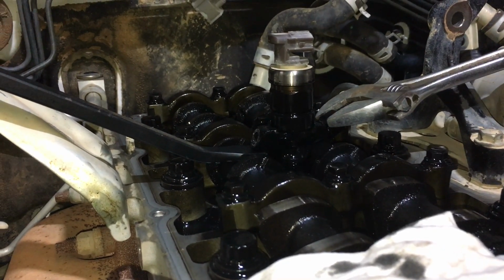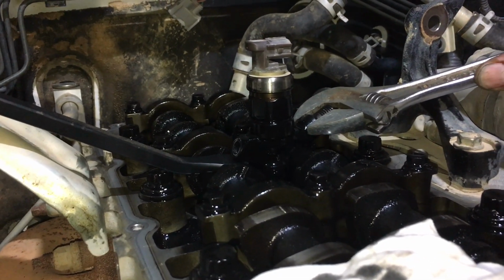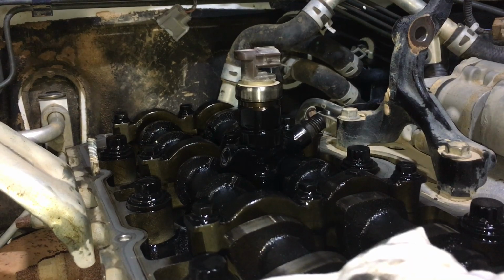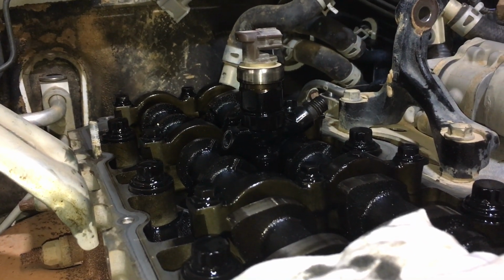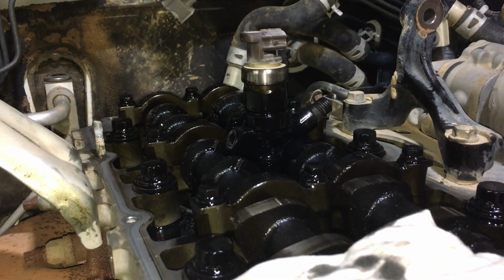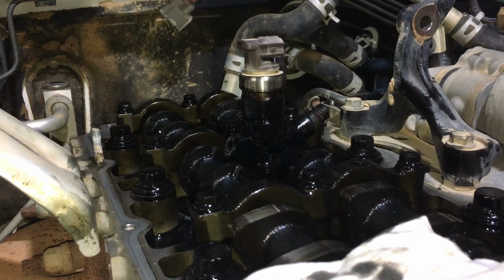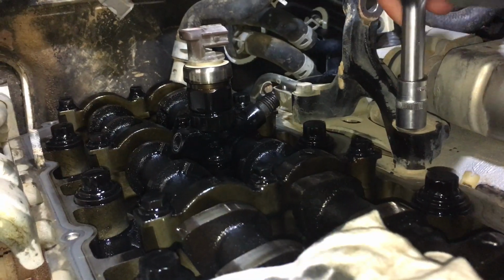So now I've changed my mind. It's going to be very similar to the other one. Oh, okay, so just stop there. What we're going to do now, it's going to be more slabs, actually. We're going to remove that stay, that bracket, out of the way, because you need more room to move. When it first moved, it had a bit of that crunchy sound that sounded like it had a bit of oil and a bit of carbon there, but now it's got that squeaky sound. Squeaky means it's dry. So I've revised what I said, and it's going to come out very similar to the other one, because you don't get that dry squeak if you've got oil, okay? So let's get that stay out of the way, and then we'll have another crack.